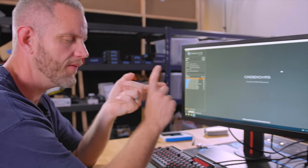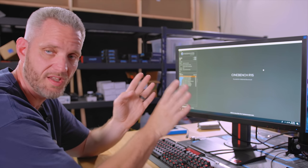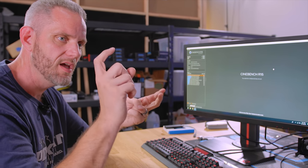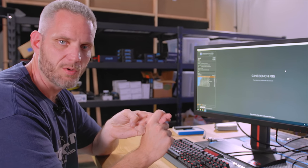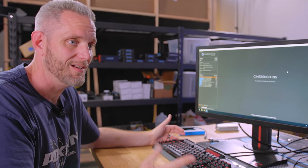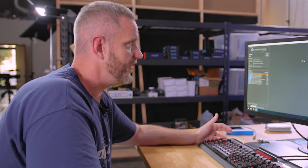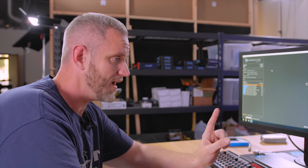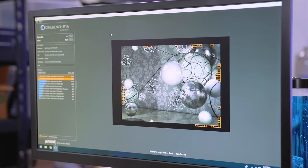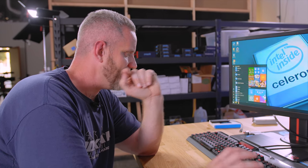So all I do is apply XMP, and on the ASUS board, it'll ask you when you apply XMP if you want to also apply an all core turbo clock. And we said no to that. So this is just RAM timing, RAM voltage, and then RAM frequency, which is based on the XMP on this, which is 3,200 megahertz. That's not that fast. When we were overclocking for our LN2 stuff, we were doing 4,000. But I want to see what just allowing faster RAM access for the CPU does, if anything. Yeah, so we lost 100 points. Interesting. For sanity, let's go back.